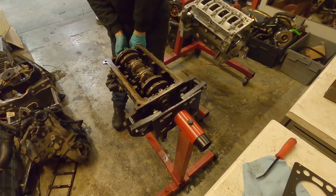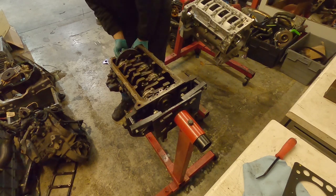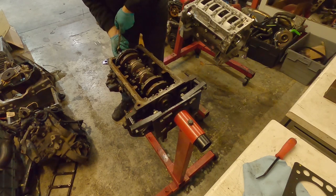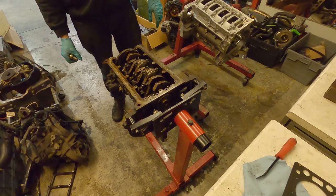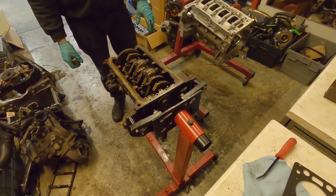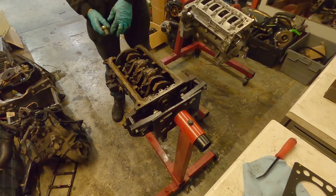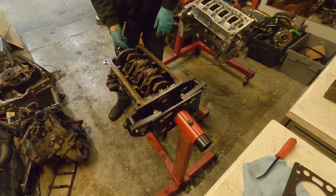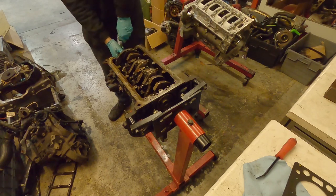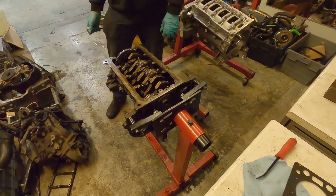We're going to set our pistons in a recessed position — piston number one just before TDC. The reason is when we start putting our head on, there's no risk of valve contact by having the cams put in, the valves pushing down, and the piston being at the top while we try to align the cams. So I'm just going to leave it in a recessed position. When we come to do our cam belt and put our head on, we don't have to worry about turning our cams — when they're in the right position, we can then bring the pistons up to meet them, and then put our cam belt on.